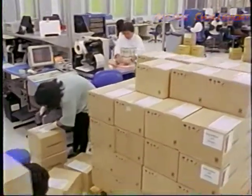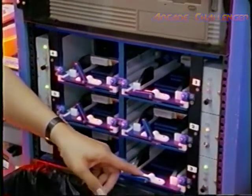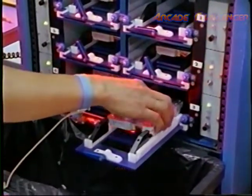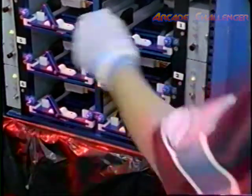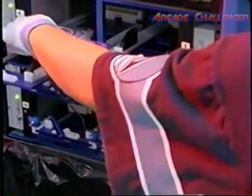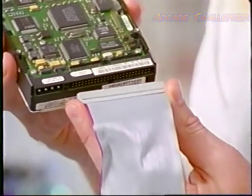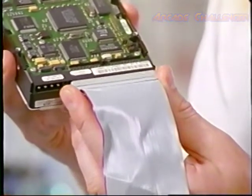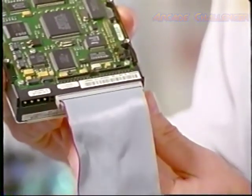During testing, and later during installation, when drives are being placed into and taken out of systems, care must be taken when connecting and securing them. These are critical times because there are many occasions when a drive is subject to inadvertent shock. While interface connectors require some force to properly seat them, this process is easier and much safer if a gentle touch is applied. The same general rule applies to attaching printed circuit boards or brackets onto drives.